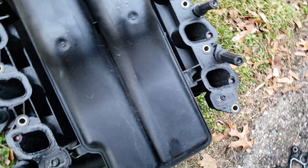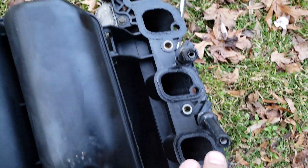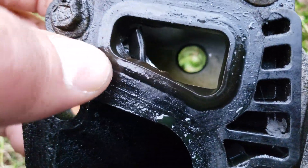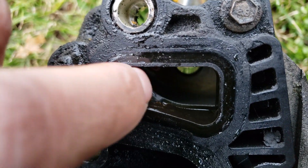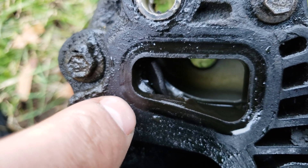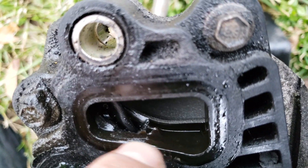When I went to the intake and looked it over, just at first glance you don't really notice any major damage. At a closer look, you're able to see right down in here — look at that, it's a big crack. And some of the plastic itself is falling off. That could even be a gasket, but right here is where the damage is, and that caused the leak.